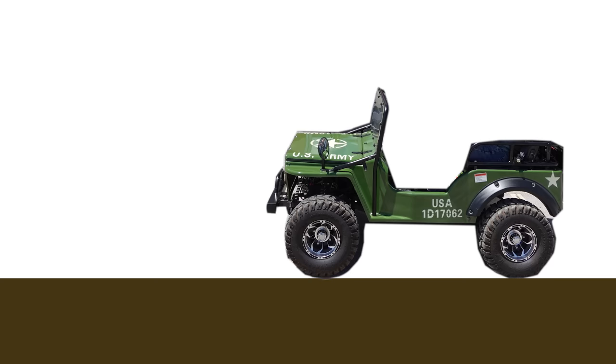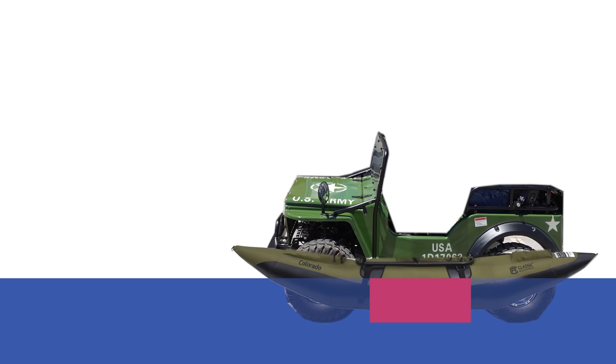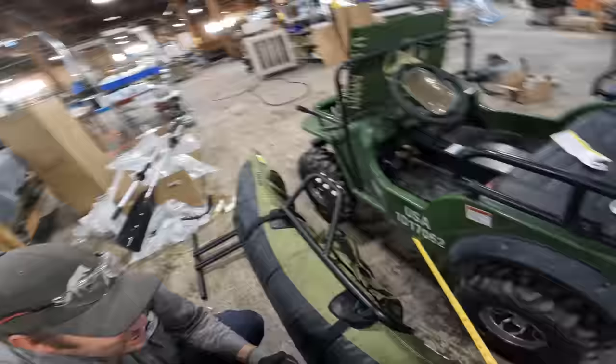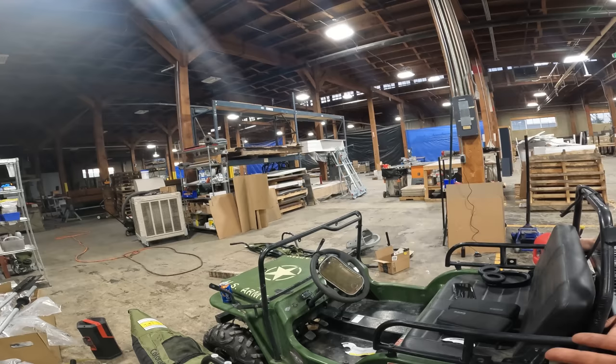We then decided that 4 inches of ground clearance below the pontoons was enough to allow me to drive with them inflated, and measured how low the Jeep was going to sit in the water with the 8 plus 4 inches. Which was good news for the tyres pushing me along. So that should give you pretty deep. Yeah, so I get the maximum traction, but this also means that the water level... Yeah, you're definitely going to be swimming. That's our waterline, right there. Jesus. Well, I'm okay with wet feet, but this also meant I was going to get wet engine electrics.